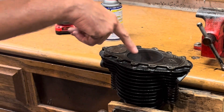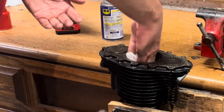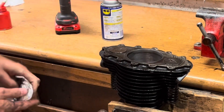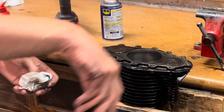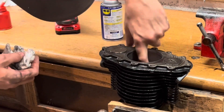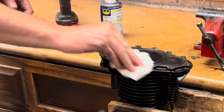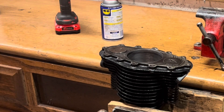When you're doing this, if you look down you can see how it's swiping the oil and you can see the angle that your pattern is honing. I'd say that looks pretty good. Our cylinder's all honed — we'll just finish cleaning this up and then it's time to work on the piston.